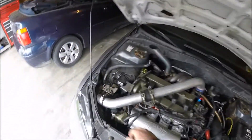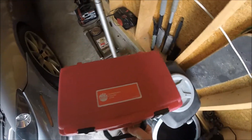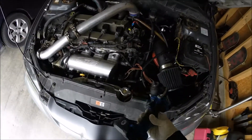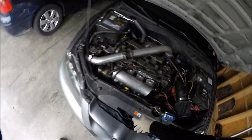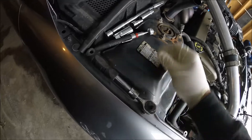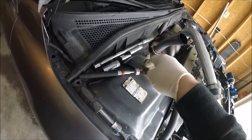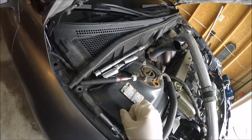First step is to take off this hot pipe from the turbo. You will need a good compression tester — don't trust a cheaper alternative. Here are all the tools we need: a Cobalt brushless drill, a 3/8 impact, a Harbor Freight 3/8 ratchet, a magnet because the spark plug socket no longer has rubber inside to grip the plug, plus an 11mm, 10mm, and 8mm for the coil packs.